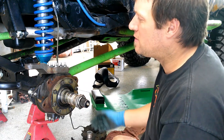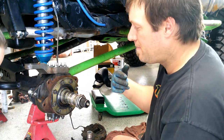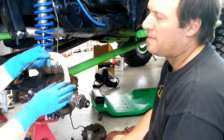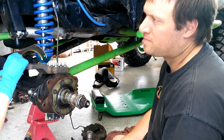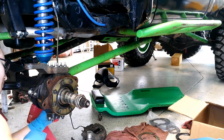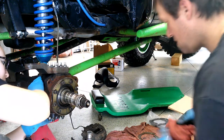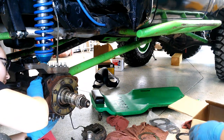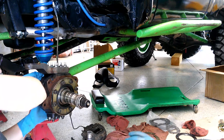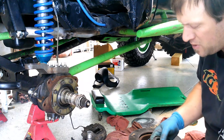Next, Ashley is going to get the seal — the ball washer seal — installed. They go a certain way: this goes like this on the hook so that you have the beveled edge towards the axle, metal ring on the backside, and you've got to make sure there's a little groove that it sits into. Trail Gear has instructions on how to install the ball washers on their website, which is fantastic — every single time I do this I always have to look up the instructions. Your rubber seal goes on top of that metal ring.